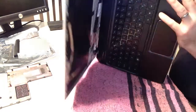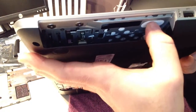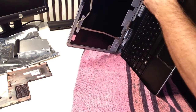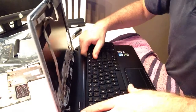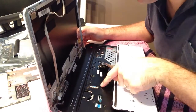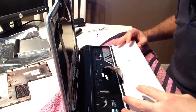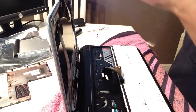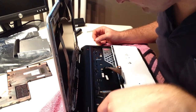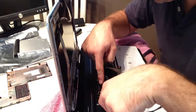So there are two screws for the keyboard — I'm unscrewing them. And there's this horrible, very unpleasant thing you have to do to get the keyboard out, which is there's this little white tab — you gotta just push it. It basically makes it sound like you're breaking the thing. It actually looks like there are a lot of connections — a lot of motherboard connectors that are exposed when you pull off the keyboard. I have a hunch that perhaps one of these is the display connector, about the same size. This guy over here seems a likely candidate — connector looks the same.